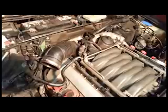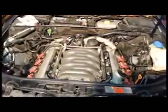I already pulled one of the ducts for the ram air — this needs to get removed. The cover plate, your air box, and mass air meter come out together. Then when you get down to this point you have to take the elbow going from the throttle body to the air box. One thing I wanted to expose was this piece right here — sometimes it's a little bit difficult for people to get out. It's just a reverse barb fitting, and this gets removed.